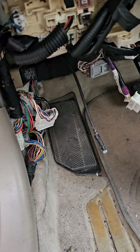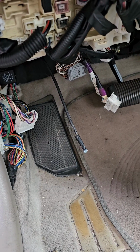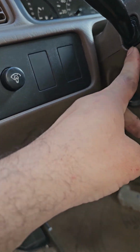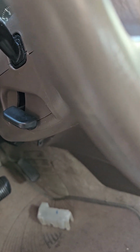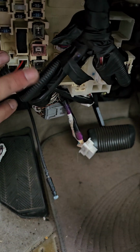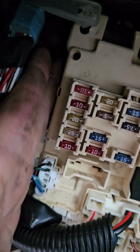Then it popped. I noticed that whenever I made a turn, it popped. Well, this little four banger is always shaking his ass off. But I checked the cluster, checked the multi switch, the clock spring. I eliminated all of the wiring, every single one of these on the fuse block. Finally found one connector on the back of this thing, on the very back.